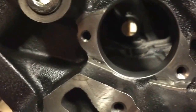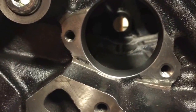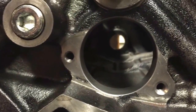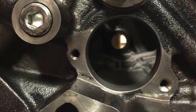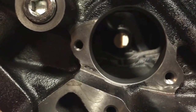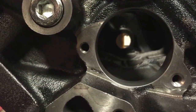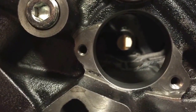If you're familiar with installing camshaft bearings, it's basically the same procedure — but in this case it's a little tricky. This will be my second set of bearings to install; these bearings are extremely tight compared to any camshaft bearing I've ever installed. We've had a little bit of challenge on the first ones, but I think we got that resolved. Right now the rear bearing — the small one in the back — is in the freezer on the installation tool. The colder it is, the smaller it is; the steel contracts slightly so every little bit is going to help. We're going to go get it out of the freezer and try to install that rear bearing.